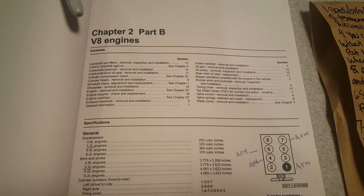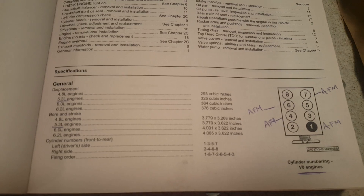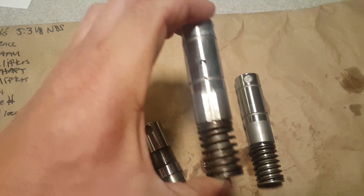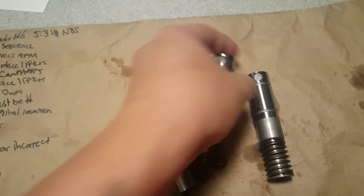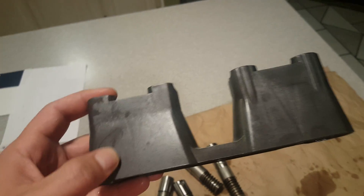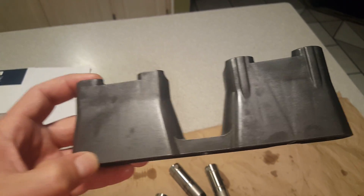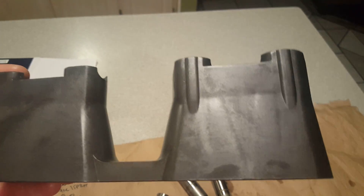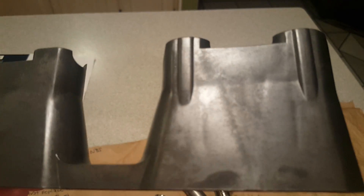That's what it looks like there. Here are the specifications on it. This is an active fuel management lifter — it has a hole in it with the spring on the bottom. Non-active fuel management lifters look like this. This is the retainer for the lifters. Two active fuel management, two non-active fuel management — the two active fuel management lifters have the grooves and the retainers right here.